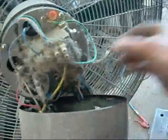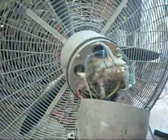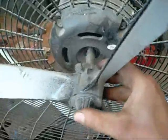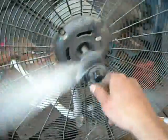Might be able to make one good one out of the two. Alright, I think I got lucky with this one - the rotor is definitely still attached to the shaft, but the fan blade isn't. I think it's just a loose fan blade - see, I'm turning the shaft and the fan blade is staying still. There's the problem. It's worked its way off the shaft - you can see that black spot where it used to be. I love it when people throw things out without trying to fix them. The bearings in it are silky smooth, there's nothing wrong with those. That's a nice die cast fan too.